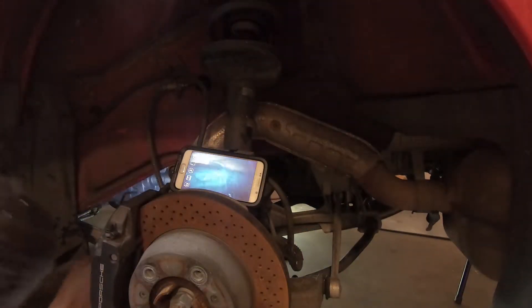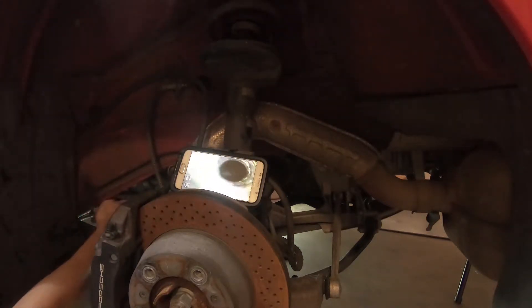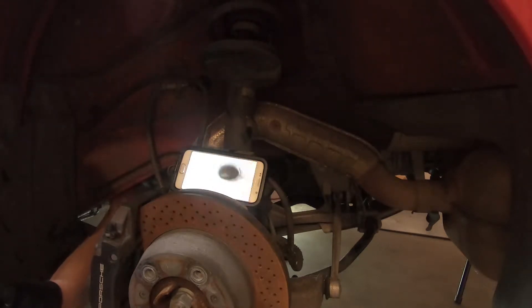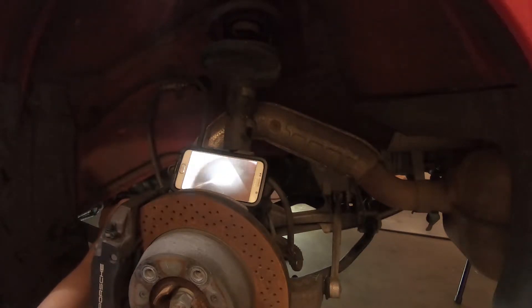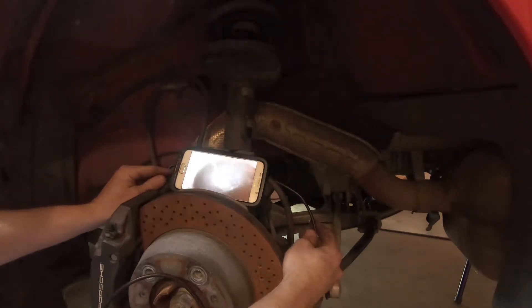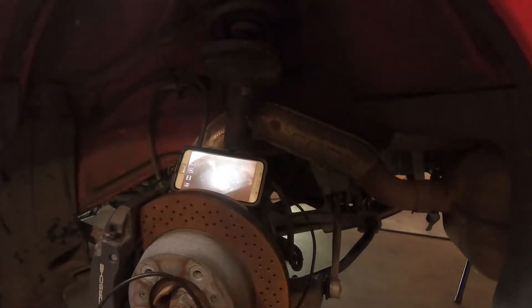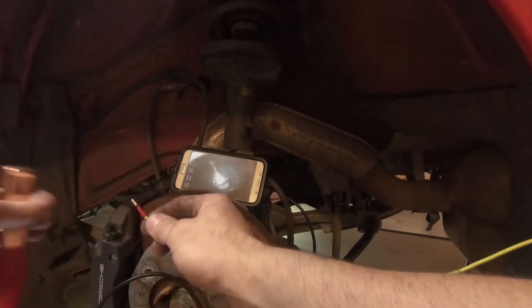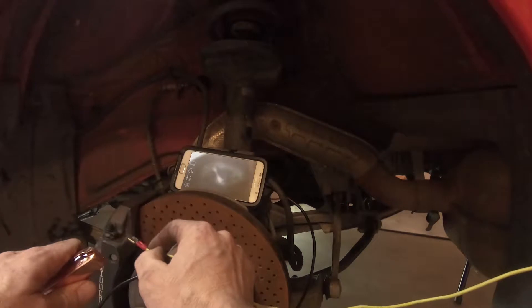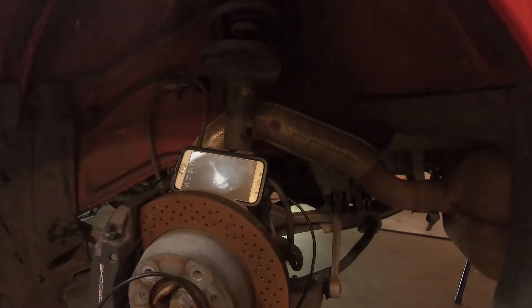So I'm going to put the borescope into the center cylinder here, and you can see what's going on here on my phone screen - it's the borescope's camera. Got to get into that hole. There we go. So now we can see the top of the piston there. I'll put the wire up here so it doesn't fall out of the hole. Then I take the jumper cable and here we go. The piston went back and then it's come back up. So now I need to connect the tester equipment.